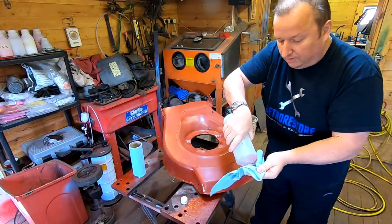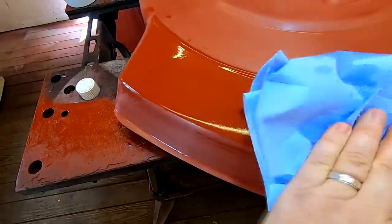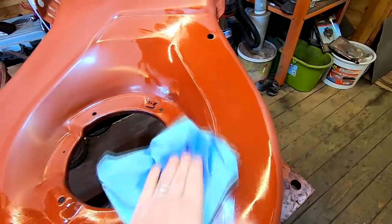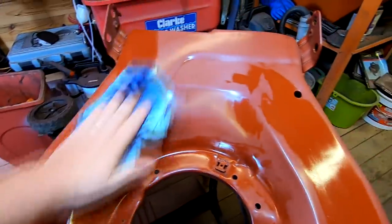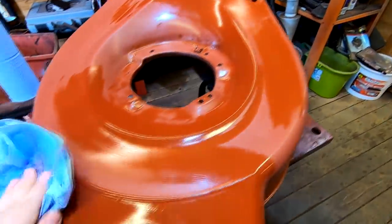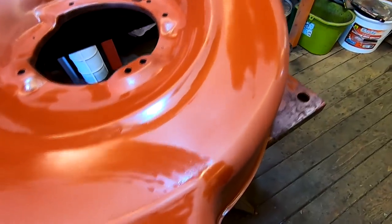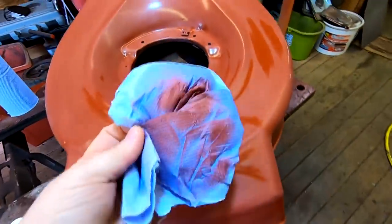And you'll probably see that when I wipe this wax and grease remover on, first of all, let me show you. When I initially wipe it on, look, can you see the shine come back? And that's exactly what happens with lacquer. But all we're doing with this, as I say, is taking off that residue. So I've got to go all over this deck now just to get rid of all that residue before I apply the lacquer. Just like that. And this literally is just to remove all the dust and contaminants. As you can see, when it dries out again, which doesn't take long at all, you can see it goes back to its original state. But obviously when you lacquer it, it stays glossy. So that's what we're doing now. That's what we're ending up with.